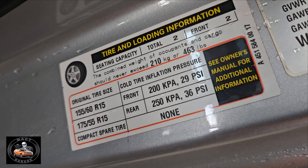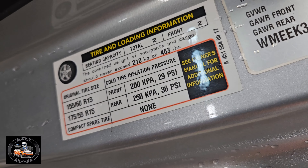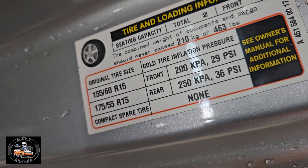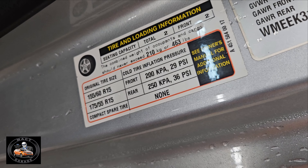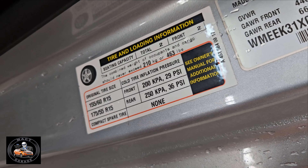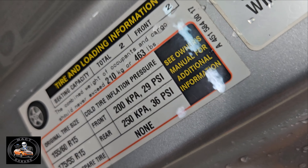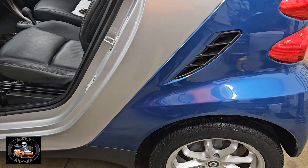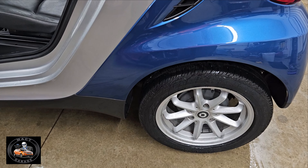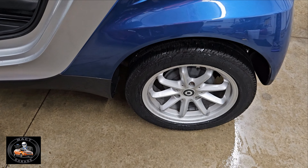One thing you want to know: the front tires take 29 PSI and the rear tires take 36 PSI. You can definitely tell the tire sizes apart. If you own one of these, when you rotate them, you can only rotate left or right — you can't go front to back. So that's the sticker on this Smart For Two: 29 PSI front, 36 PSI rear. I wonder if that affects how it handles, because we had the fronts on the back and the rears on the front — driving was a little squirrely.